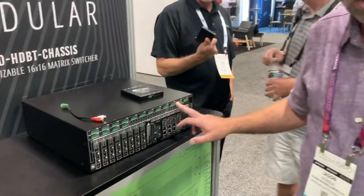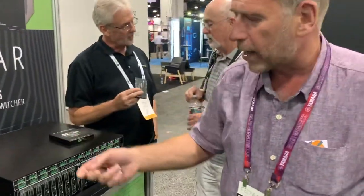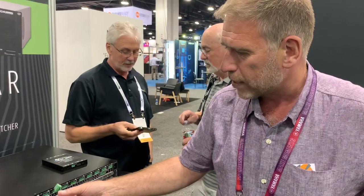These are all the audio extractions in balanced line level audio and we can provide these adaptor cables. This will also give you volume control, so you can come straight out of here into your amplifier and use the control system interface to control volume. You've also got audio delay, which you can apply to get perfect lip sync.